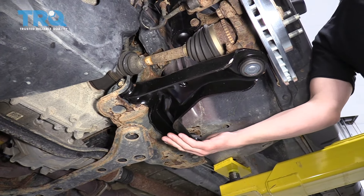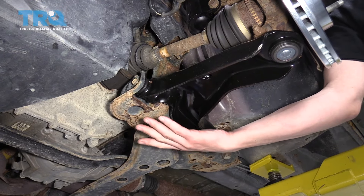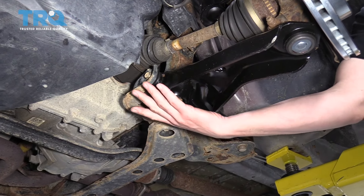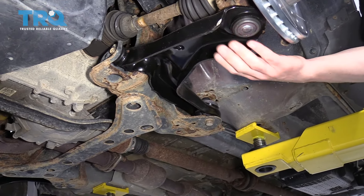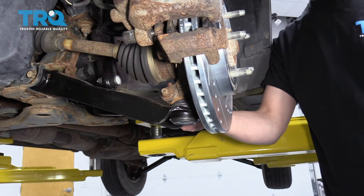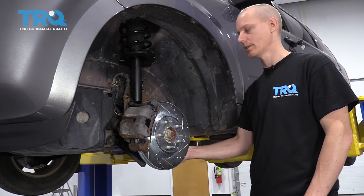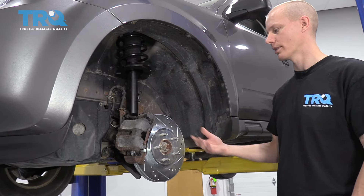With the control arm there are usually three or four bolts that hold it in place. In this case there's one up towards the front that connects into the subframe — usually some pretty large bolts that are very tight, so it can be a wrestling match to get them out. Using rust penetrant will save you some headache, and air tools obviously help if you have them. You'd remove the front bolt and the larger one in the back, then come up to the ball joint and disconnect it. In some cases there's a bolt; in others there's a castle nut with a cotter pin. You'd pull the cotter pin, remove the castle nut, then use a ball joint press or hammer to remove the ball joint from the knuckle. At that point you can remove the control arm from the vehicle.